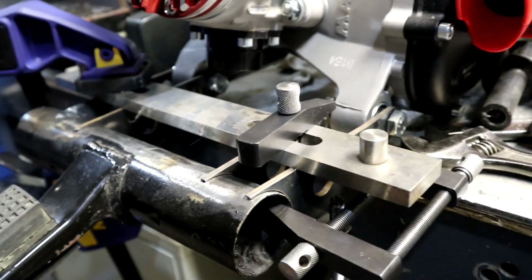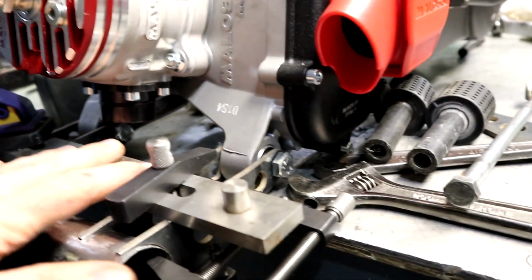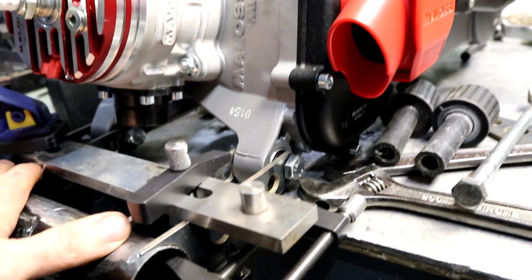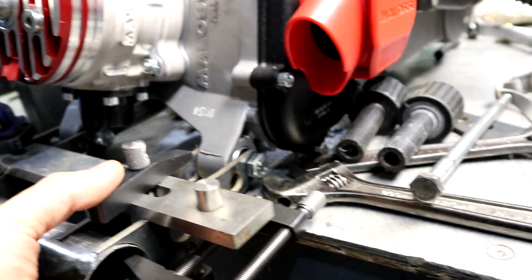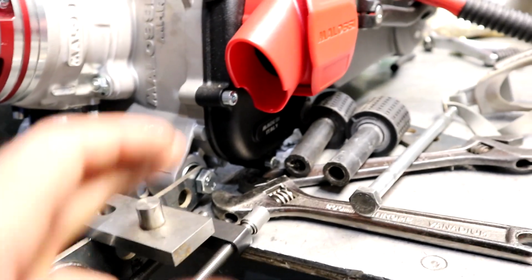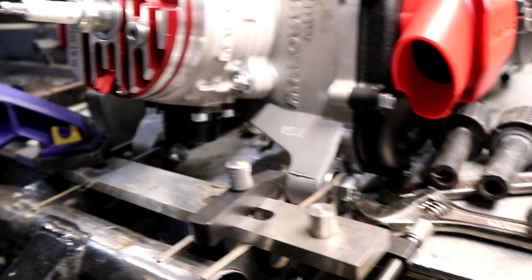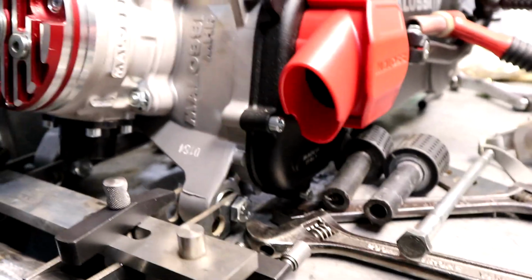My new method now is I have put this parallel bar onto the tops of them and then sandwiched it onto that, so it should be running fairly flat to that. And then I have checked the alignment of everything. This clamp is just holding everything square, so now I can tack the tops and the bottoms and hope maybe even get a tack on the sides as well.